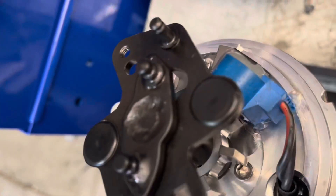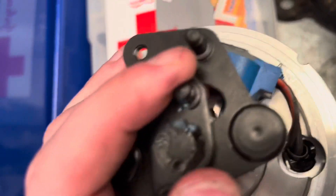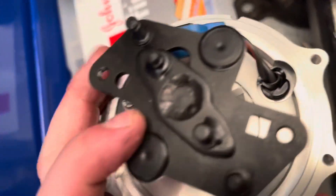I hammered out that pin. I rotated this 180 degrees - you can see that the nut and stud is in the lockout hole instead of the adjustable eccentric hole where it can slide around. So now it is solid. I cannot advance or retard the timing. It's locked. That's locking out the mechanical timing.